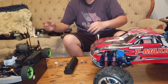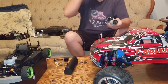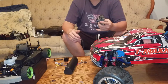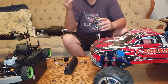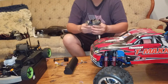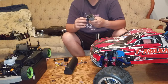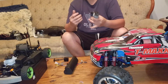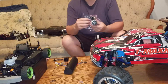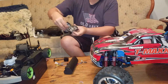Now that we've gone over what's needed to start them, let's cover the methods. The very early vehicles — airplanes — had a propeller and you simply spun it over by hand. Since these don't need any spark, all you had to do was put a glow plug igniter on it, spin it over by hand, and it started. Very early versions had a carburetor but no throttle — it would stay at whatever RPM level you set it at, and then you'd fly it.